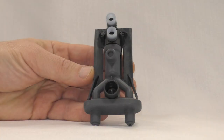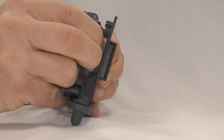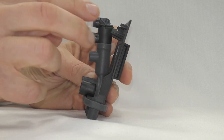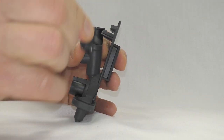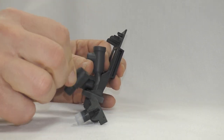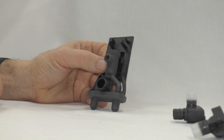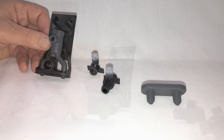Now for proper and thorough cleaning I'm going to disassemble the main dispenser nozzle. We're going to hold the dispenser at the sides and pull it forward to release. We're going to turn the upper connecting piece and pull it upwards to remove it. Then remove the lower connecting piece in the same way. The Y piece will remain in place. Pull off the dispenser nozzles and clean all parts thoroughly.